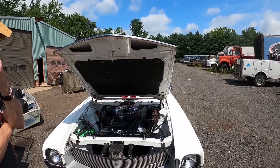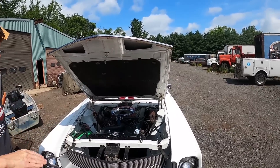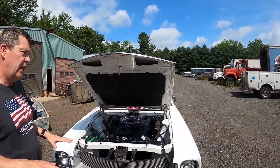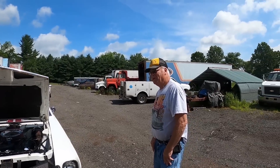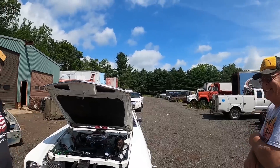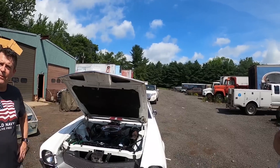The old tires? They were somewhere — a little dry rotted. But on top of that, every bushing under the car was replaced. The springs in the back were really gone — after I got it home, Ralph, the back end started sinking and sinking. So the springs had to go. Parts are tough for these because AMC doesn't exist anymore — it hasn't for decades.